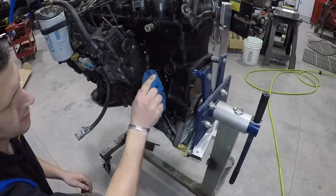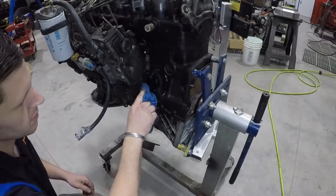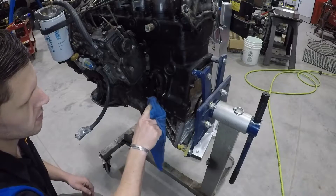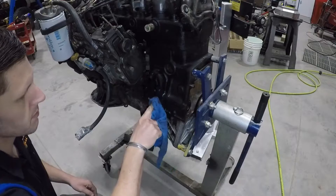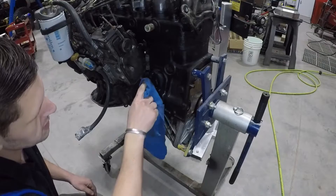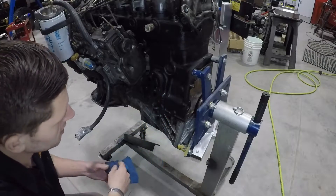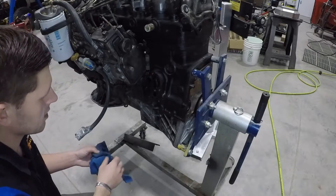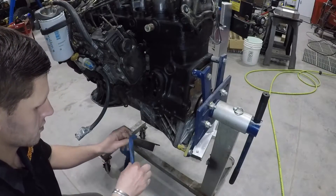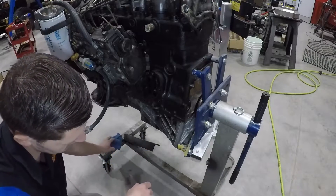Keep in mind, this is where your oil comes from the oil pump, and then this is where the filtered oil goes. So you want to be pretty cautious with how you work with this — you don't want to be sending trash into your motor. Once we get that wiped off, I'm going to go to my favorite tool, which is a 3M Roloc disc, and get this all cleaned off.